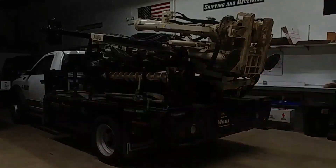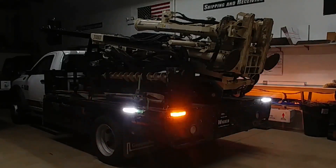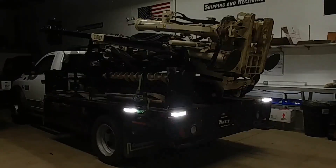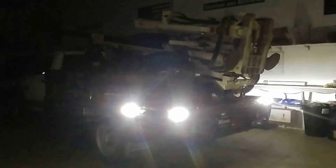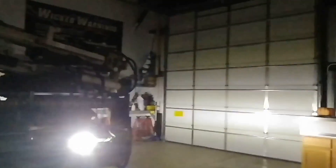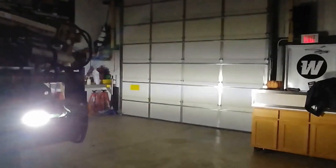You can see what I mean when I darken up that camera just a little. We also enabled the rear flood so if the workers needed a little bit of extra light, they can hit switch number three on the factory auxiliary switches and enable the rear flood mode. Just to show you the brightness of that rear flood — we are in a dark shop with the shop lights all off and the rear flood active. You can see it's illuminating quite well, easily illuminating the back of the shop and the sides.